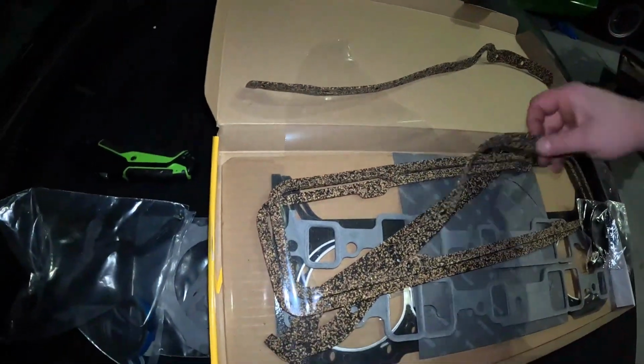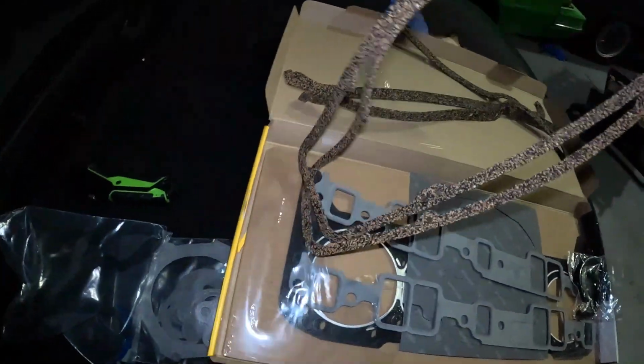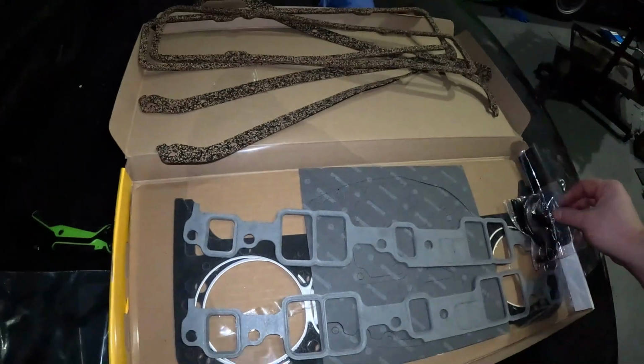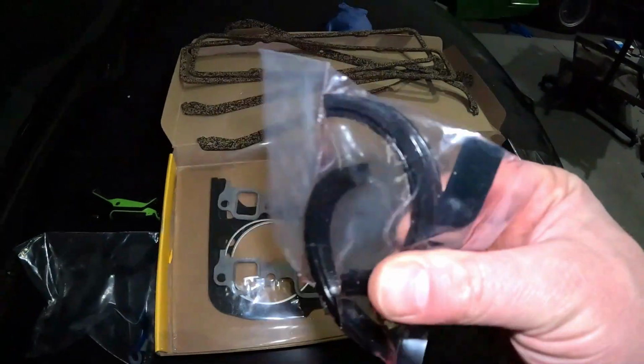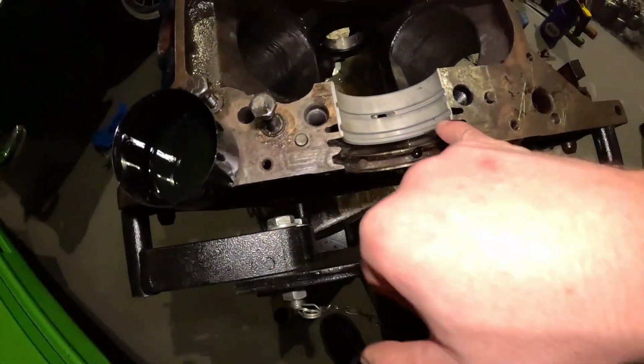Here we got sump gasket, option on sump gasket, cam cover gaskets. These I thought for a minute would be correct, but they're too small. So yeah, there's no point me putting the crankshaft in just yet, because obviously we haven't got all the seals, and that's not going to be possible to put on after the event, because it's got a nice kind of taper to it. So yeah, the next step on this would be put the crankshaft in, put the caps on, torque the caps to spec, which you will see in the next video.